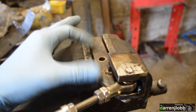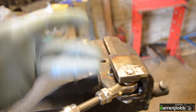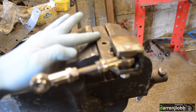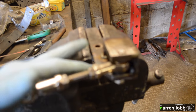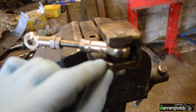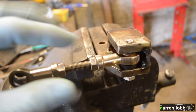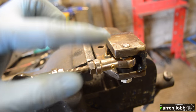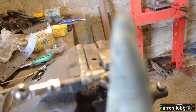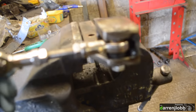So this is the arm that was in there originally — the pivot arm. You've got the master cylinder at this end, and this is the end with the tie rod that connects to the clutch pedal. Originally it was just a flat bar — basically a piece of M8 stud welded to the very end of this single 10mm piece of bar stock, which then bolted the tie rod on, with nothing supporting the stud. Obviously the strain over time, it's been walking forward and back to the point where it snapped off, which is why the clutch pedal went to the floor.